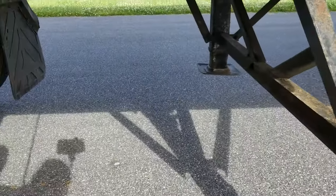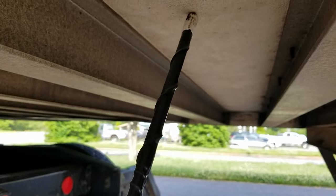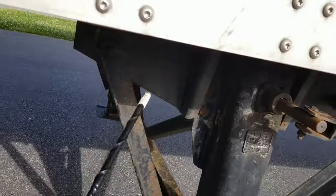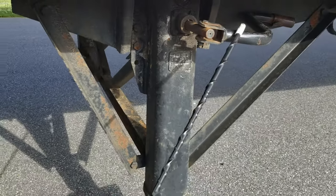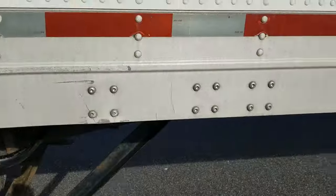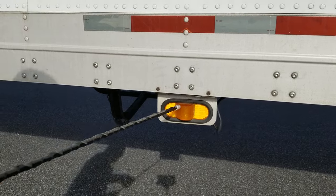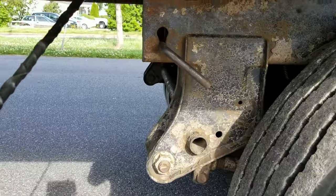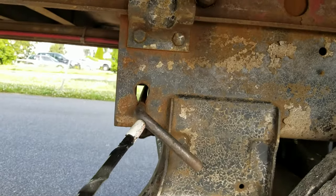While I'm here, I also want to check my cross-members to make sure there's no broken, cracked or damaged cross-members. And I'll check the floor of the trailer to make sure there's no holes or damage the entire length of the trailer. I want to check my landing gear to make sure there's no apparent damage, no loose or missing bolts, the handle is secure in its cradle, and the legs are fully raised. I want to check my light here to make sure it is amber in color, not cracked or broken. I want to check my sliding tandem, make sure the pins are locked in place, the handle is in and secure.